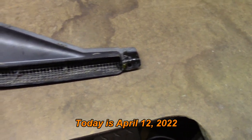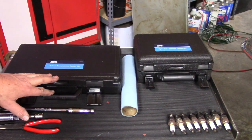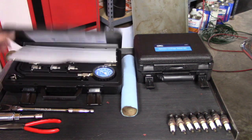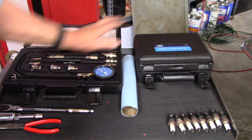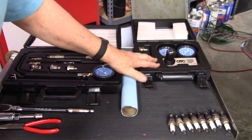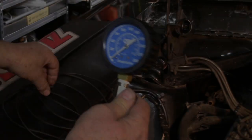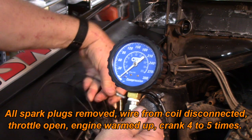The tabs I glued on have been overnight and the glue is still pretty tacky, so I'm going to let that set for another day before I install it. I now have the tools from Amazon - OTC brand, which comes pretty highly recommended with good reviews. A lot of high-end mechanics on YouTube use these. I have the compression gauge set and the cylinder leak-down test kit, which I've never owned before. Let's get the cylinders checked out on this engine - I'll be able to show you this bank because I can turn the starter over and hold the gauge at the same time.